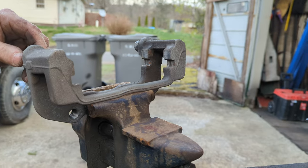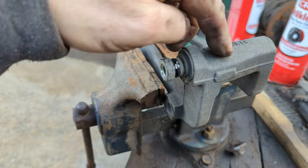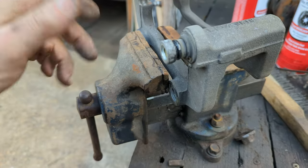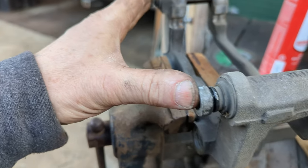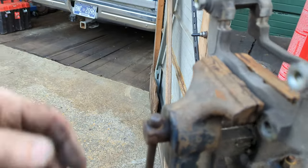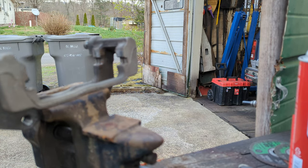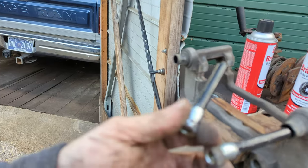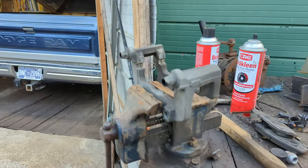These guide pins - here's what they do. They just sit in there; they do not bolt to the bracket. They just glide back and forth, they're just floating. If you can pull them out and they go back in, that's good. These do that. A lot of folks would just say they're good enough to go, but today I'm going to pull them completely out. No big deal - they go back in the same way and both of them are pretty much the same, so there's no issue there.